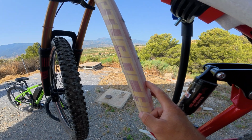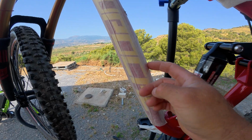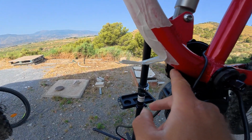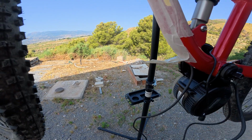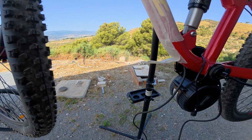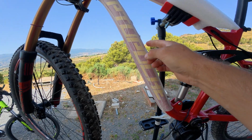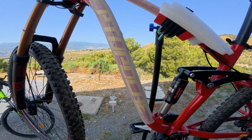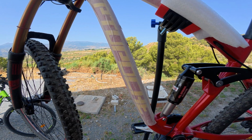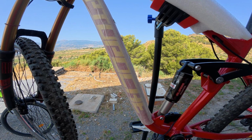Now, the actual cables on the battery mount are quite short, and they're certainly not long enough for me to put them in there and then to come out of here and then me cut these and solder them together. And in the reverse way, this cable is not long enough to go in there, up there, and come out here so I can solder at this point. So I had to buy some more cables, disconnect them from the battery mount, and solder the new ones on.